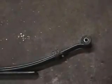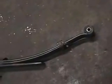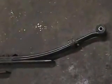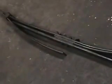Anyhow, it's all set to go. I did replace the bolt that I cut with a grade 8 piece of hardware from the local hardware store. Working well, no issues. Some washers and a lock washer, and reuse the old nut. Put the U-bolts back on and tighten those accordingly, and then the rear hardware and shackle were reused. If it is something that you're going to be doing, or a vehicle you're going to be keeping, I'd recommend doing both sides, replacing both shackles and all new hardware.